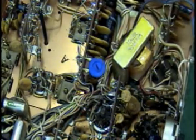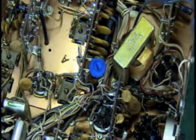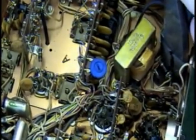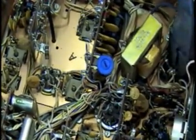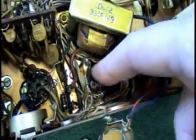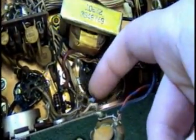Now for the easy removal — this may seem a little scary — I'm going to take some wire cutters and get right underneath the terminal of the cap, and clip those terminals off so that you keep the wires going to the terminal. You'll have a road map then, instead of unwiring them down this little hole. So now you can see the wires are all disconnected, just by cutting the lugs off the filter cap. Lost my little 1K resistor in the process, but I think you can afford a nickel there.